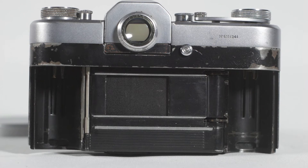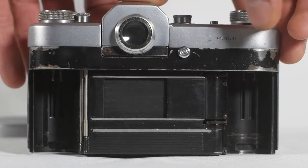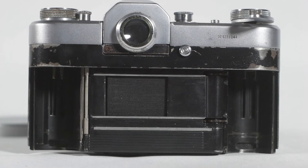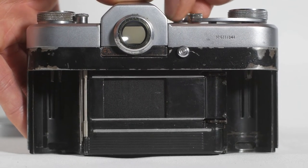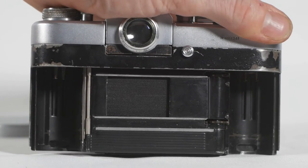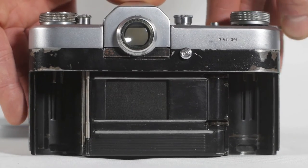When I bought this camera on eBay it was described as fully serviced and tested, and it said it works correctly on all speeds. So let's have a look at that. If I trigger the shutter at 1/125th of a second it looks about right. But at 1/60th of a second the second curtain is very slow and doesn't actually close fully — that issue is consistent every time 1/60th is selected. At half a second the results are inconsistent too; sometimes it's considerably faster than a half-second exposure. These issues are present throughout the slower shutter speeds and it's likely to be a problem with the clockwork slow-speed delay mechanism.